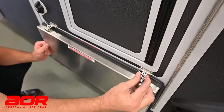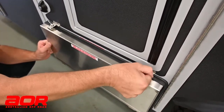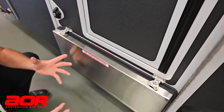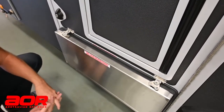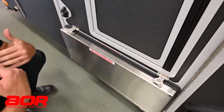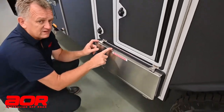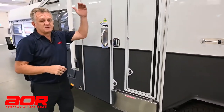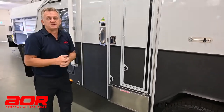I'll do the same on the other end — pull that around, and that pulls the whole thing in, lock them down into place. It can't come undone, it can't fall off, unless you haven't done it up properly. But now that's giving you 100% dust seal around that area there, stopping any potential dust coming in from this point, but also coming in through the air filter in the top — the positive air side can't keep feeding inside of there.